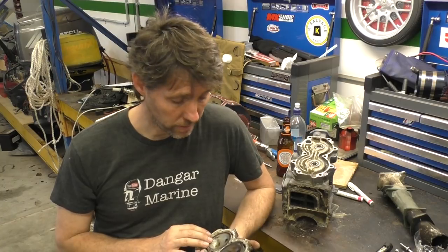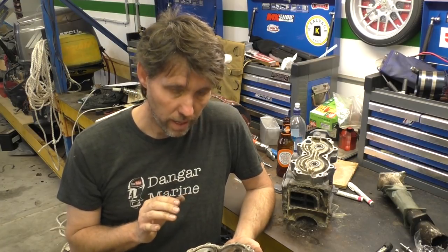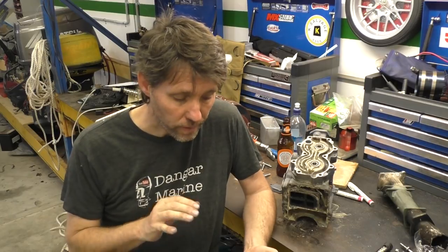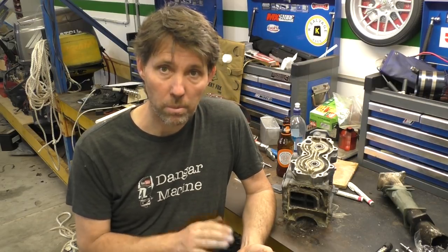Oddly, this motor had perfectly even compression on both cylinders, which goes to show compression tests are a little bit hit and miss. Another big clue was the nature of the telltale — it was quite forceful and sporadic in its pulses. That's exhaust gases coming past the cylinder through a blown head gasket, displacing all that water. The water was being pumped in by the pump, but exhaust gases were much stronger — pushing exhaust gases into the water jackets and flushing water out with such force it actually flowed backwards out the telltale. So a forceful, sporadic telltale is a really good sign of a blown head gasket. Although the cooling system was working perfectly — good pump, good thermostat, no blockages — it was the blown head gasket causing the overheat.